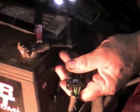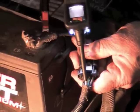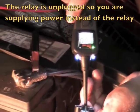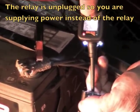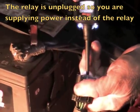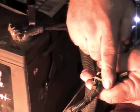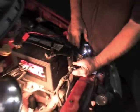We're going to bypass the relay. Power comes in on the gray and goes out through this green. If we power that green wire and it's got ground, then the cooling fan should run. You can hear the cooling fans running. So that means we're taking the place of the computer — we're actually powering the fans and they're running. So that relay is bad.